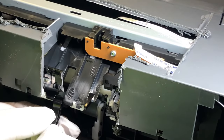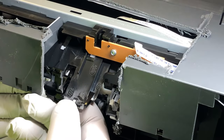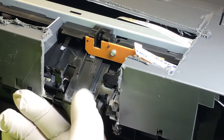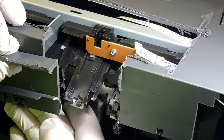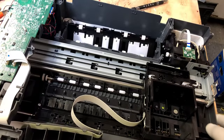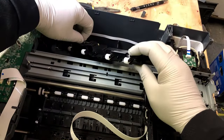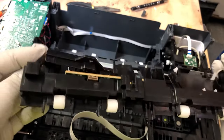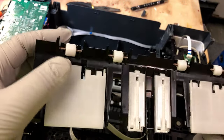To install, just offset it, slide it in on the axle first, then bend it backwards. I removed the bottom so there's nothing stopping the little box moving back, but in reality there's a bottom to stop it, so the box will slide in easily. Now you can take the whole board out by disconnecting the cable, and you get access to the tray sensor, and you can take the electronic board if you need to replace it, or just swap in a new one.